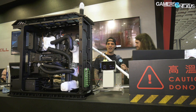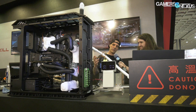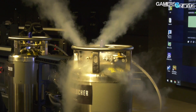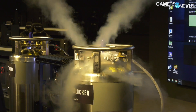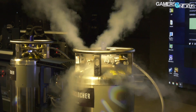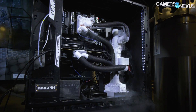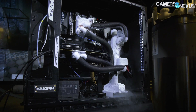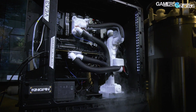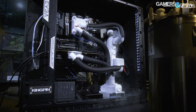So what's the first step here? Test the limits of the CPU. The CPU is good for about 5.7, so I think that's the target. I want to make sure that the CPU is stable and can run, and then we start to worry about the GPU, but focus on CPU first. We're at 5.6 now. What voltage do you have right now? We're using 1.5V vcore and about 2.35V on the VIN for the 7980XE.